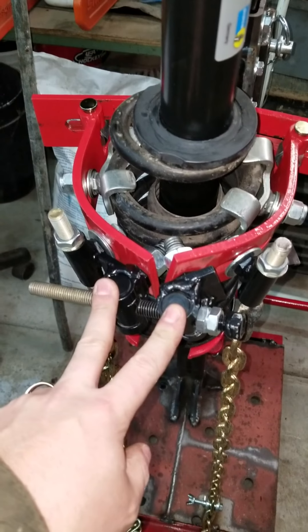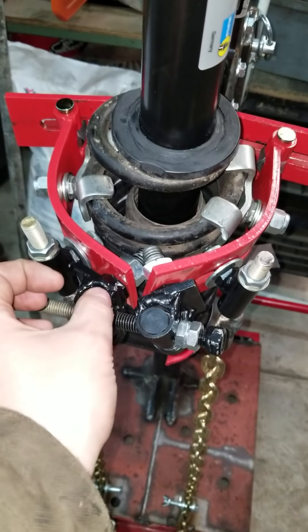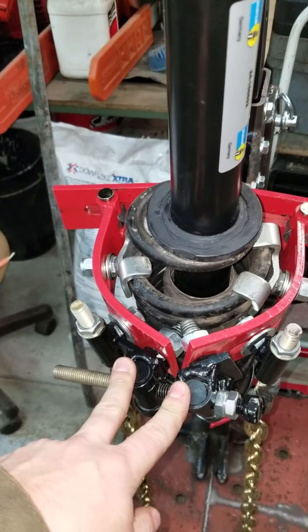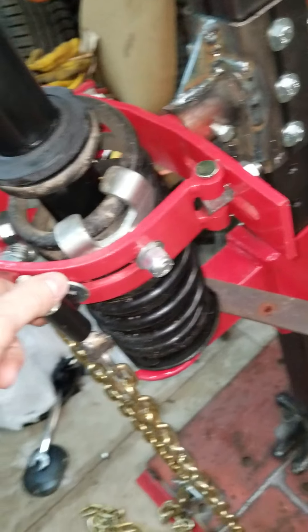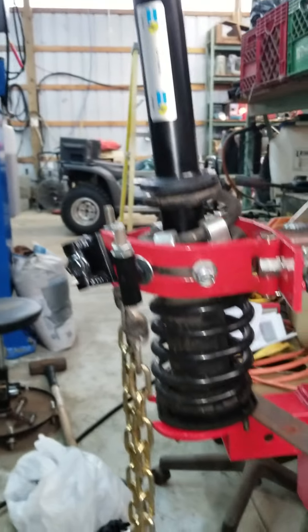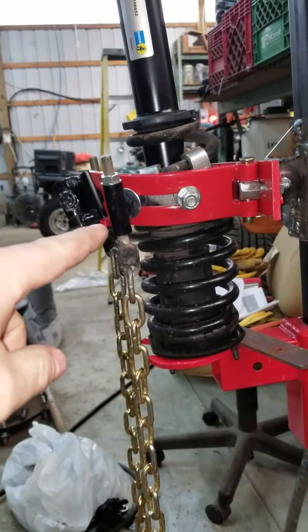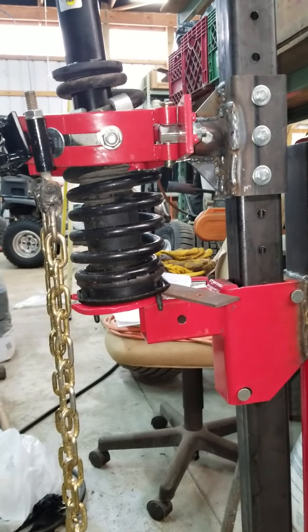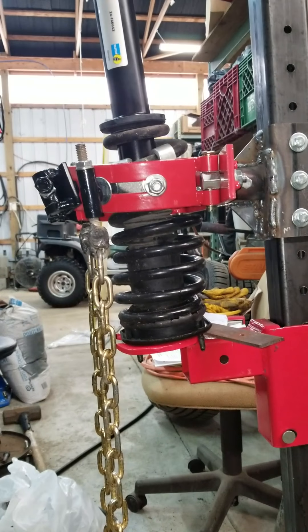So I decided to do this. Each one of these can rotate this way as well as this way, and this one's threaded. This one has a hole through it — you just run the threaded rod through it and it tightens these down. I added these as well, which provides support to this arm assembly and keeps it from buckling up. Each one of these chains comes down and it's hooked onto a clevis onto the base down here. This whole system works really well — this thing had no trouble whatsoever compressing the spring for the ML.